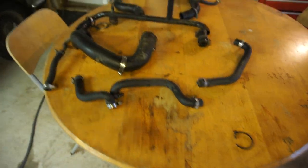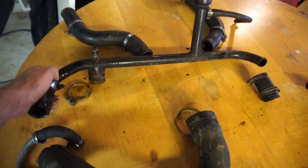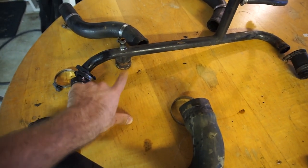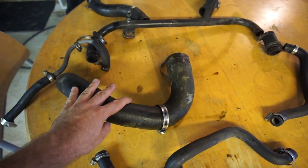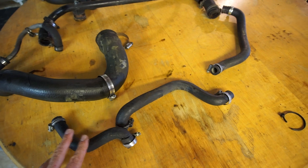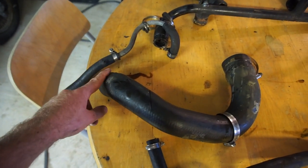I've laid everything out on the table here, roughly where it goes on the engine, to try to show it in an easier way. So here you have the left and the right top hose, where they connect to the thermostat housing. Right below there you have the bypass — two short hoses there for the bypass. Then you have a hose that goes up into the block or right above the water pump. Then you have a hose that goes from the bypass, basically an air bleed, over to the expansion tank. You have the lower radiator hose that goes from this side of the radiator and then straight up into the water pump. Then you have the hoses in the back for the heater — into the heater valve, out of the heater valve, into the heater core, out of the heater core, and down back.